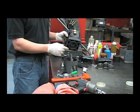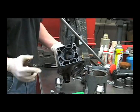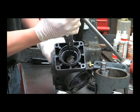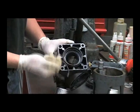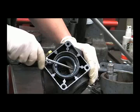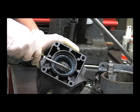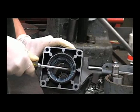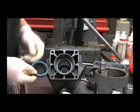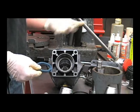I'll show you how to remove the lip seal that separates the crankcase oil from the gearbox oil. You'll need to use your large snap ring pliers. Remove the snap ring that holds in that seal. Then, to remove the seal itself, take a flat blade screwdriver, place it behind the back of the seal, and in a twisting motion gradually work it off. Be careful not to damage the inside of the housing. This will only need to be replaced if it's worn — if you're starting to get crankcase oil back into the gearbox oil. You'll notice this if the gearbox oil is overflowing and the crankcase oil level is going down.